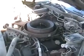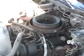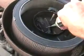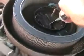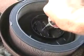Okay, now we didn't put any gas in the gas tank. Before we spend any more time in this car, we're just going to squirt some gas into the carburetor. If it fires up, then we'll proceed to the next stage to see if the transmission's good, and then we'll get the whole thing going. We'll probably have to do a redneck gas tank system, of course, it's so rotten underneath. This is good enough just to see if she'll fire.